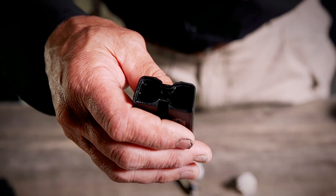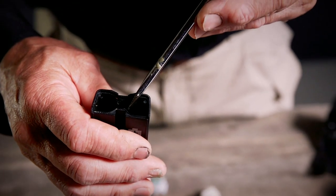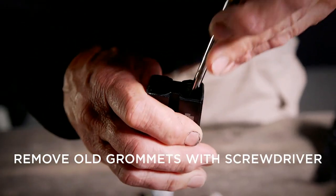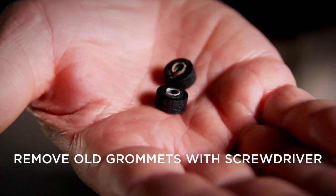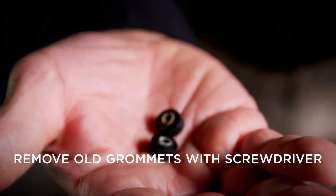Here you have a different battery compartment that still has the original rubber grommets in. They will have to be broken loose if they're not loose — you do that by applying a little bit of sideways pressure with a screwdriver and then they come out. You can see that they've got corrosion and oxidation from battery leakage and years of use.